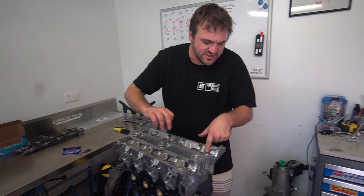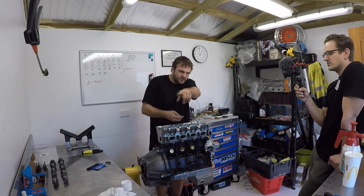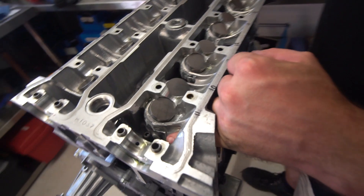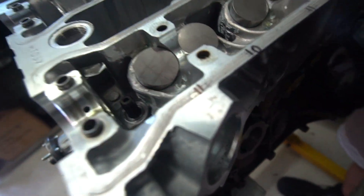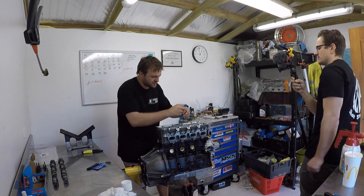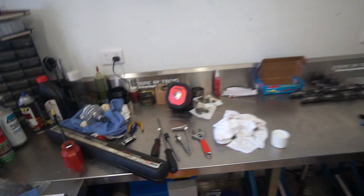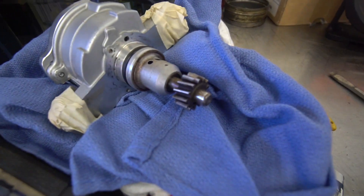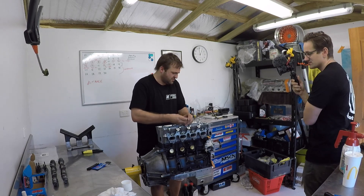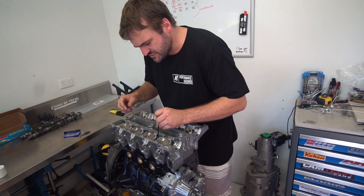The 16 valves have a tendency to hit the crank trigger. See the snout off the end of the gear? That can actually hit this stud. As the cam comes through, the gear will actually hit it, and you'll see guys try and tension the dizzy in — but you'll snap the arm off where you bolt down because it'll fail on that stud. So you've got to get a grinder and put a little chamfer on the end of that shaft, or you'll end up with big problems.